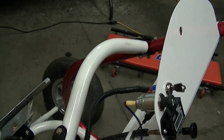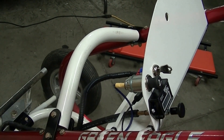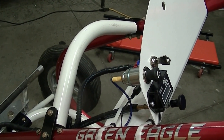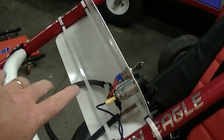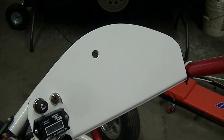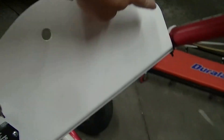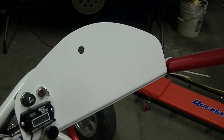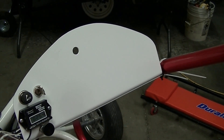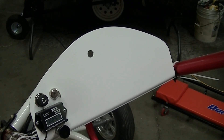When you get a Green Eagle you have a dash bar that goes across. I didn't want to mount a dash directly to that bar because I didn't want to put any holes in it, and also my reserve parachute fits in that space. So to save yourself some money, go to a sign shop and ask them for some junk aluminum scrap. This piece is 16 and a half inches wide by about 15 inches, and I traced out the front dash onto that aluminum and cut it with a jigsaw.